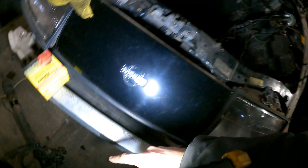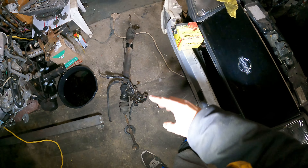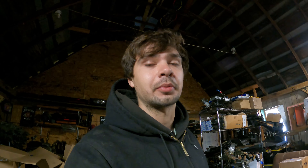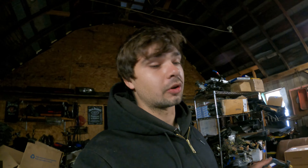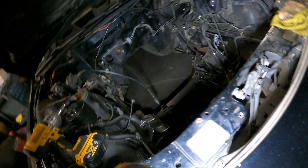On the steering gear, on the opposing side to where it clamps, there's a double tooth — instead of it being fully toothed, there's a gap, so there's a thicker tooth on your steering shaft that slides in and keys it to fit a certain way. Don't just start banging it on if you don't have it in the right position. Make sure to lube and clean both ends so they stick together and you don't have seizing issues in the future.